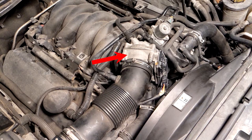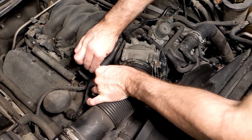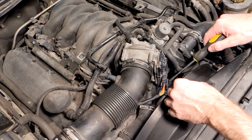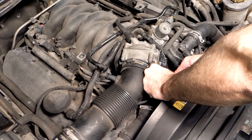First, open the hood and locate the throttle body. Once located, you'll notice an air tube adjacent to the throttle body — I believe this is called the full load tube — but you can just pinch the sides and remove it. Next, you'll have to remove the wiring harness that's connected directly to the throttle body.